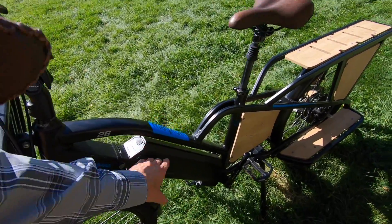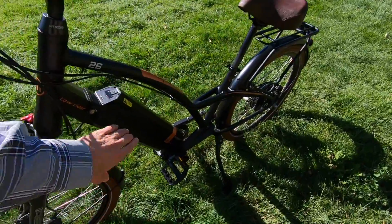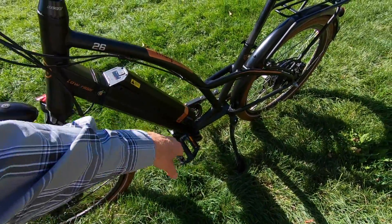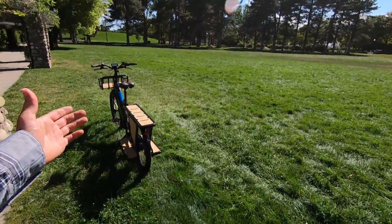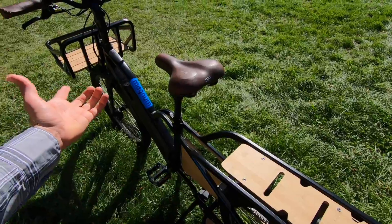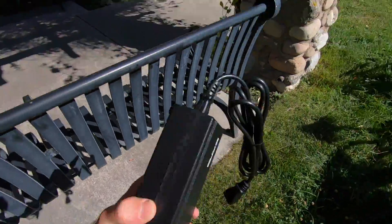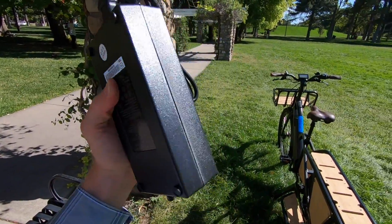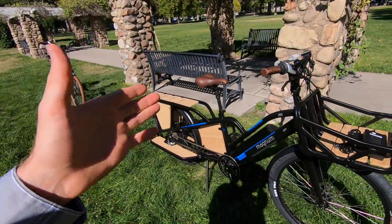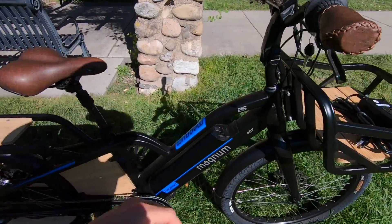That battery is cross-compatible with the different models — so if someone in your family gets the lowrider, this battery pack could go for either one of these bikes. With so much cargo capacity, you could put a long bag back here and take an extra battery with you. You could also take the charger along — this is a pretty basic charger, the same one for all their bikes, 1.5 pounds, two amps. It's not the fastest, and especially if you get that 19 amp-hour battery, it's going to be slow going — I think this one's like six and a half hours to charge from empty.